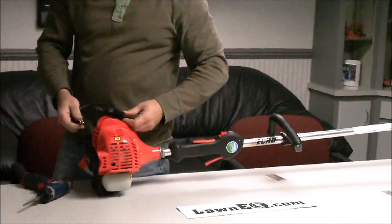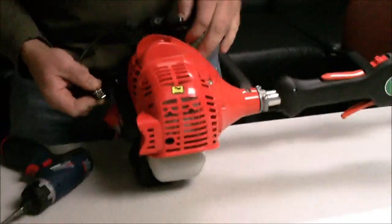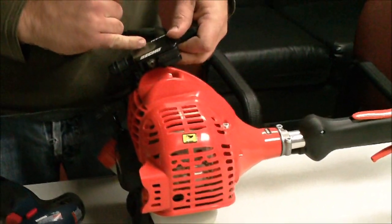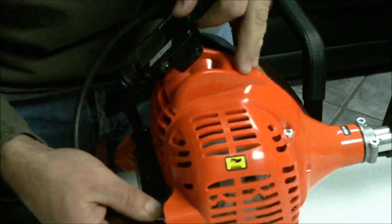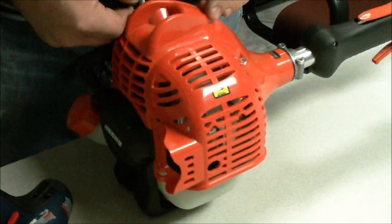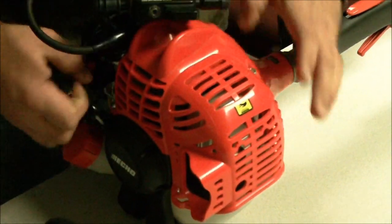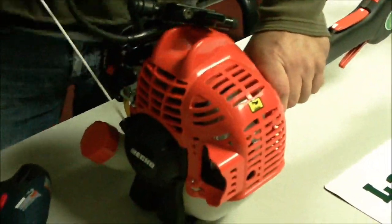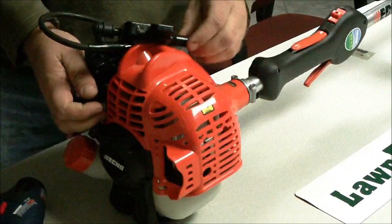Get a spark tester if you can. Some people just try to ground the plug out, but that doesn't work very good. You're going to plug the tester into this — you need to have about just under a quarter inch gap, they say it's .16 inches. Then find your ground and hook onto the plug or engine fan and pull the engine over. Make sure there's no gasoline around the area so you don't start a fire.